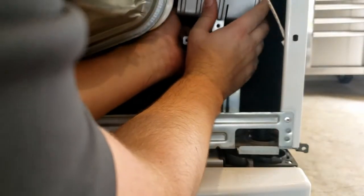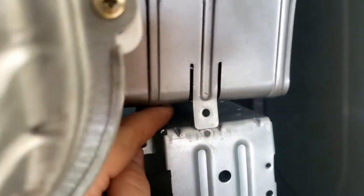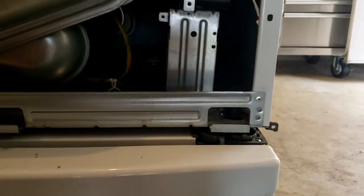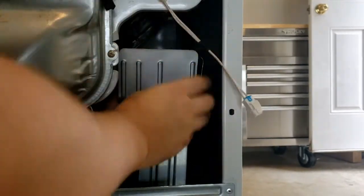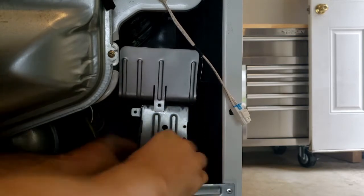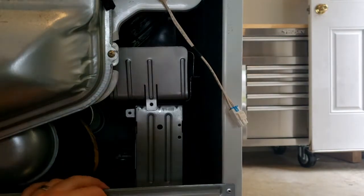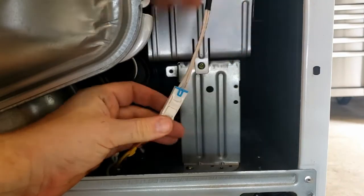Push these two tabs in there. There's a tab right here — a thin strip of metal that has to go into a slot in the top of the mounting bracket. Make sure that aligns or it won't slide down. Now line up the bolt hole, and there's the mounting bracket — just screw it all into place. One final thing with the heating element reinstalled: make sure you reconnect this connector right there.